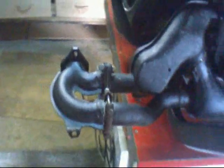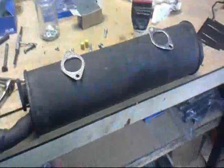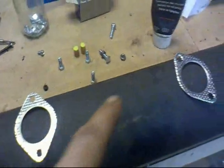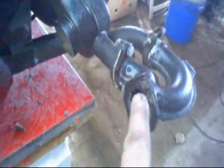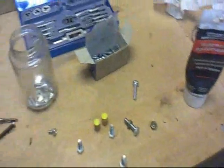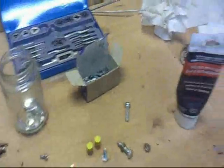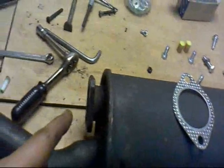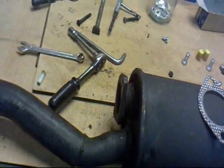It's starting to look like a CT engine. The next thing to fit is the center box, for which we use two new gaskets assembled with gasket compound and exhaust assembly paste. The only problem is that with the kit it gives you very, very short bolts, because it's assuming the threads in here are going to be spot on. So I think we might have to cheat our way around that a bit.